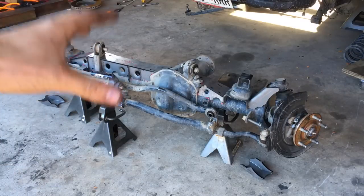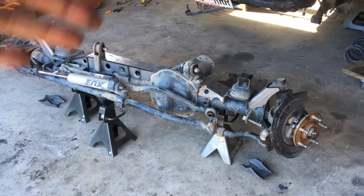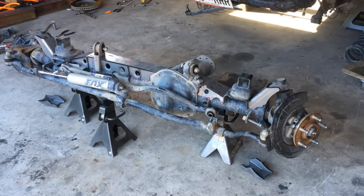There are a couple ways to do this. You can actually leave the axle on the Jeep — if you're going to do that, just make sure you have enough clearance to see everything and weld all the spots. Also, when you're welding on the Jeep, make sure you unplug your positive and negative battery terminals — negative first, then positive. You don't want electricity going through your axle and short-circuiting your Jeep. TIPMs are not cheap and new batteries are not cheap.